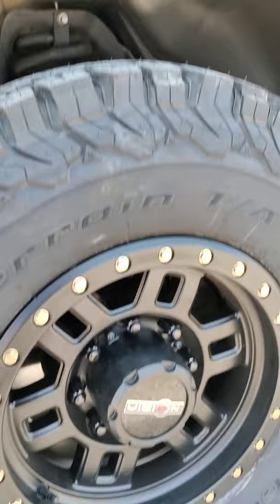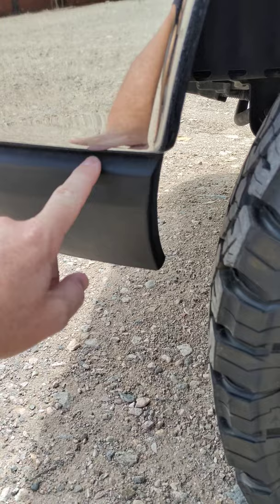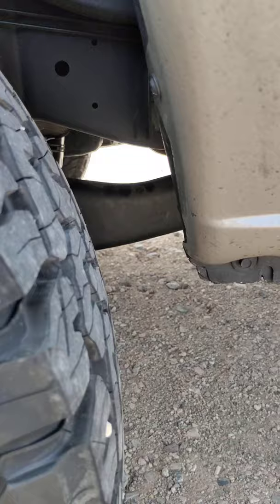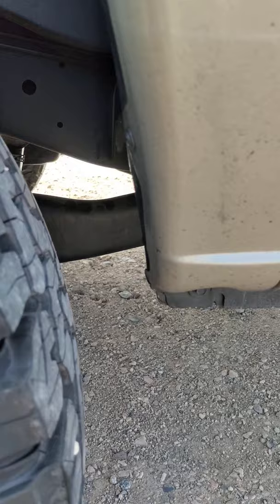This does not rub. There's plenty of clearance. I'm actually going to build a front bumper for this van. The pinch seam has not been changed or modified, and the tires don't hit — there's plenty of clearance. That's at full lock both ways. I've taken it out in the dirt and it does not rub. If for some reason something happens with your van and it does, it's easy to turn your wheel and either use a sledgehammer to push the pinch seam in, or cut it down to give yourself clearance.